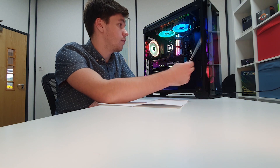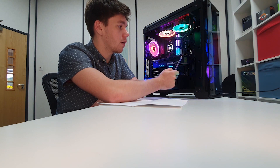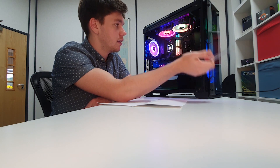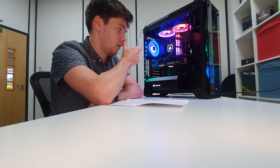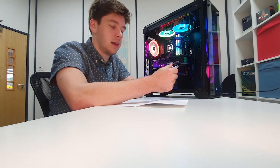You also want to make sure if you already have a case and you're upgrading — these are pretty big cards. Check the spec on the website for the card's length, because small ITX cases can leave you with very little space. This is already a big case and we've removed the drive bays to fit a card of this size, so if you have a smaller machine it can be quite tough to fit a large card.